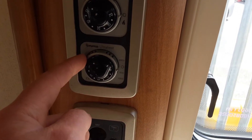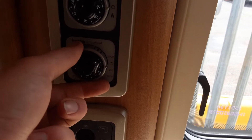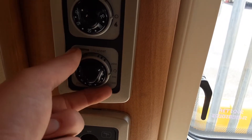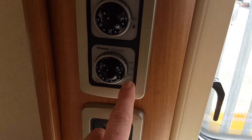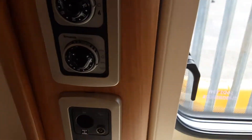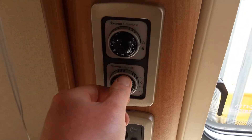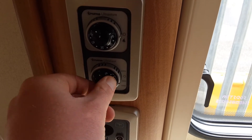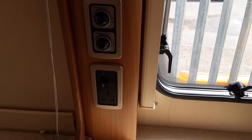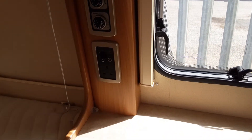Down below that you have the room heating for the caravan. You need to have the space heater main power switch on in the cupboard for this to work. Down the side here you'll see 500, 1,000 or 2,000 watts — depending on what caravan site you're on, you can spin the outer grey dial to one of these three power options. To know what to set this to, you would need to ask the site's office when you arrive. Once you've selected the correct power source, you can control the temperature on the dial in the centre between 1 and 9, which relates to the number of elements in the heater being warmed up — the higher the number, the more elements and the more efficiently it will heat.